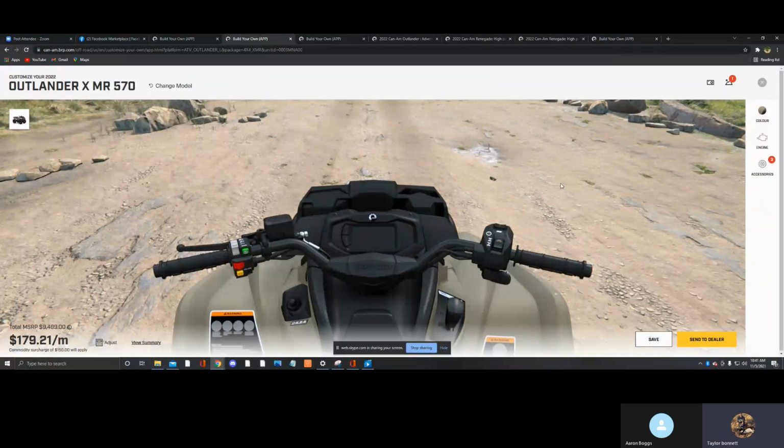But from what I've experienced, when you have a brand new one, the QE Visco lock will kick in after the tire that's spinning spins one time, 360 degrees around. But after it gets older, like a year to 2 years old, that's when it starts to wear off, and like you said, it's good to have that manual diff lock.